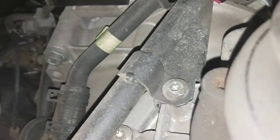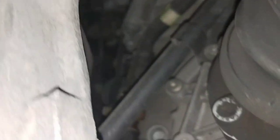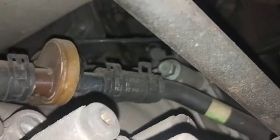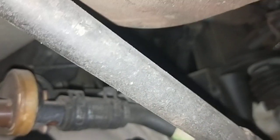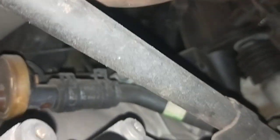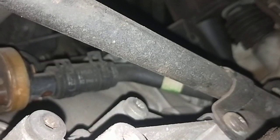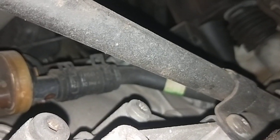Today I've put the car up in the air to find the leak. You can see around there — see that little red mark at the bottom of that hose there? That little red mark is a cooling leak from the heater tap.